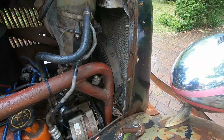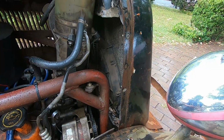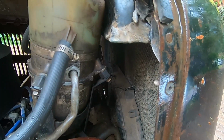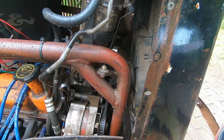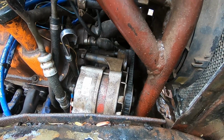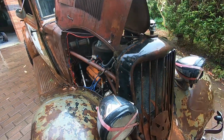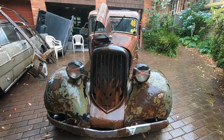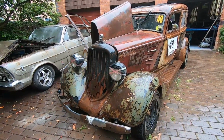So as we look in the engine bay, we'll also put some bracing from the roll bar to the radiator support. It is wobbling around a little bit. We do have a cracked radiator that reared its head last time, so we've got to take care of that. And we also want to address, whilst everything's apart, the alignment of this belt for the alternator, because it did come off and it cost us about 13 minutes. Outside of that, she's pretty well good to go. Just the usual active servicing, checking fluids, that's about it. Best we get started.